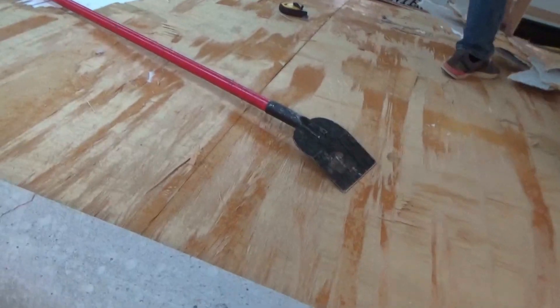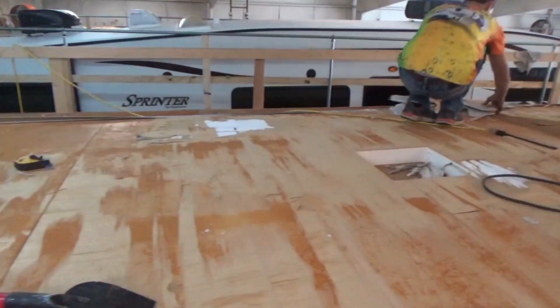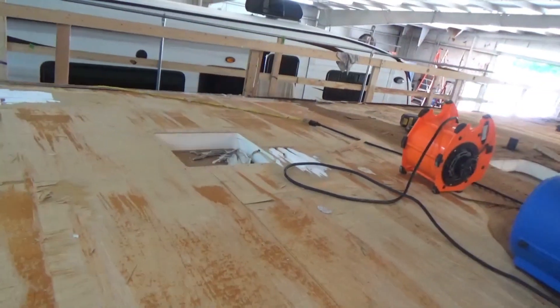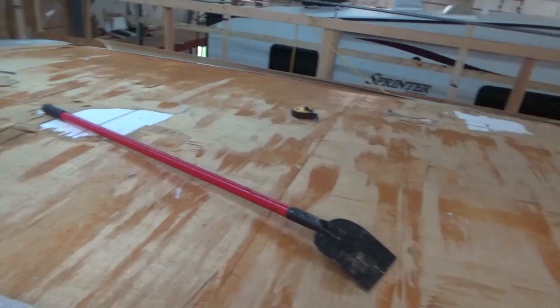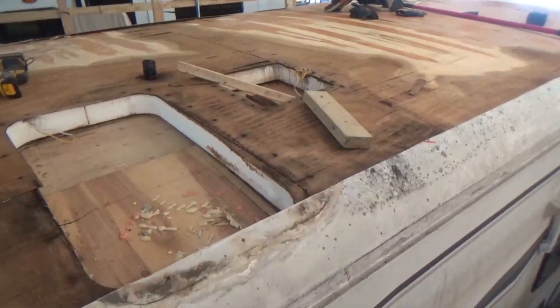It's come down quite a bit — took out quite a few plies on there. You can see that's foam right there; it's polystyrene foam. It's a ply-foam roof assembly. The way it is: you have your roofing, you have that foam right there, then underneath the plywood is the foam, and then inside right there is your ceiling panel — that's how it's comprised. It's all one component; that's where you get the strength of the structure. We're more than likely going to have to re-deck it to get a good roof on here. More to come.